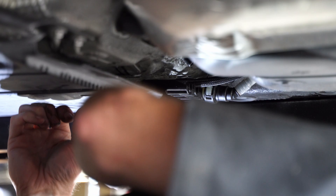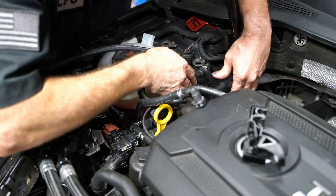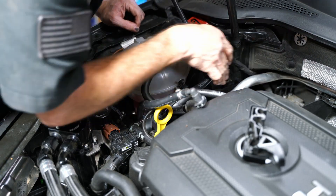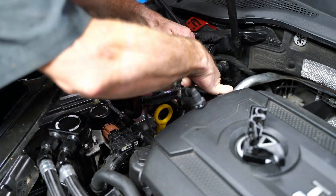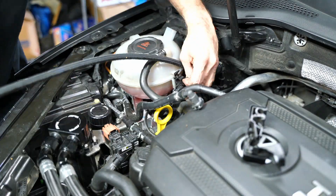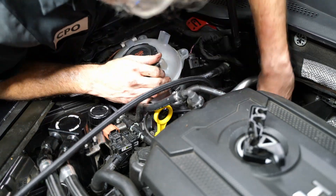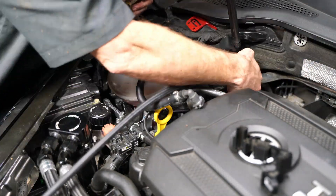Getting this elbow-shaped plastic cover back in is also a pain. I did cut that little section that was enclosed at the end pointing backwards to make it less restrictive. Then I just worked it through patiently and got my fuel line run where I wanted to, and eventually got it pressed back into the side of the engine compartment. Once you do that, you can put that top piece on — I didn't really make any modifications to it — and then put that one nut back on to hold it all together.